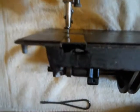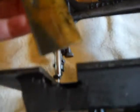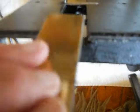I just got the slide plate to move. It was very smooth on the top surface, so I didn't want to force a screwdriver down and push it open. But underneath, going through here, there was more of a ridge that was in between the narrow needle plate. So I was able to put the screwdriver in like that and turn it, and the slide plate moved. I don't know why it was stuck — there isn't an awful lot of gunk on it. So that's one problem solved already.